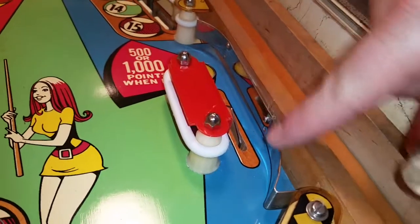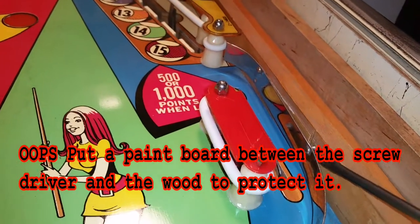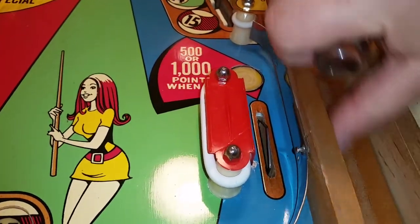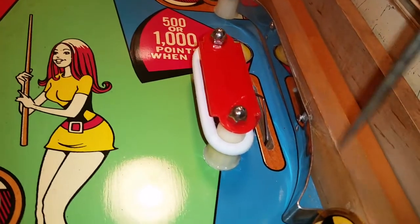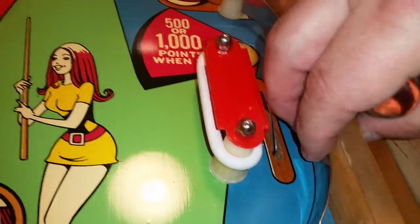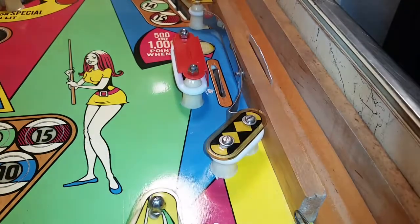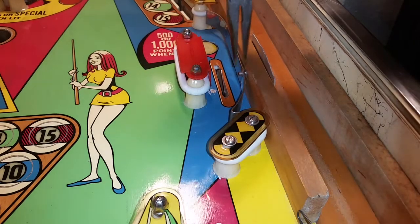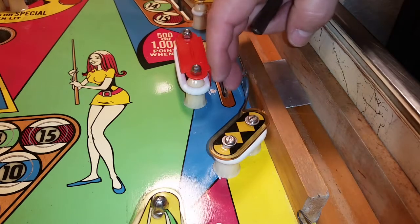You remember this area where the ball wouldn't go past it? What I've decided to do is pull the rail out a little bit, get a pair of needle nose pliers straight down on here and twist it back in, then gently press it back in — maybe put a small piece of wood here and use some channel locks. I should have used a backer because I did damage a small part of it right there, but you really won't notice it that much. I'm going to get those needle nose pliers and press it back in. Take this and press it out a little bit, hold it down — now it sits all the way down like it should.